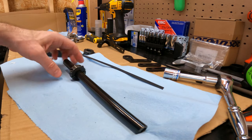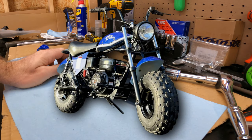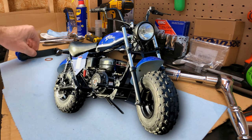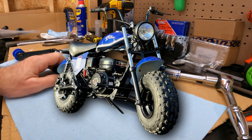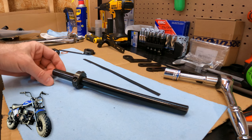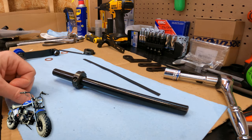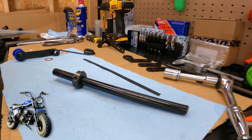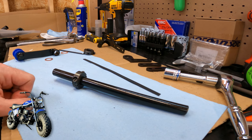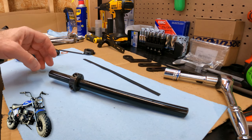I want to show you guys something — this is for the MB 200-2 Trailmaster. I'm showing this before other stuff because even a stock bike could use this mod. The chain is so long, and the way it loosens when the suspension is fully extended and tightens as it goes up into the travel — even stock, I had it hitting the back of the driven pulley. This is going to help with my 60-tooth sprocket and longer shocks.